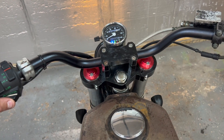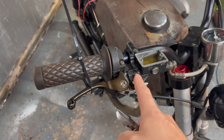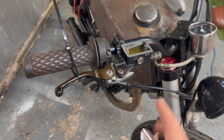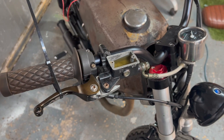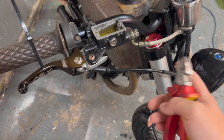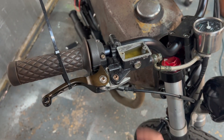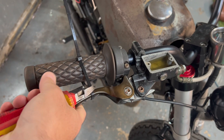In this week's video we'll be taking the bike for its MOT to see whether it's ready. The front brake felt a little bit spongy still, so maybe there's a little bit of air left in there. I've cable-tied the brake lever overnight, so that way if any air is in here, hopefully it would have worked its way up and out through the top. That's the theory anyway — whether it works or not I'm not sure.